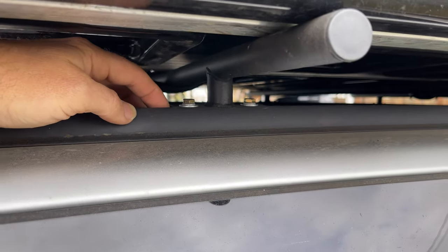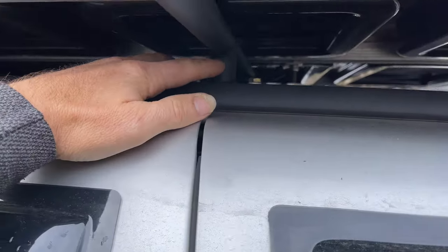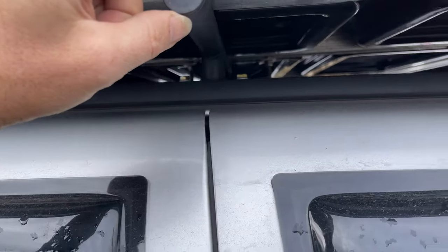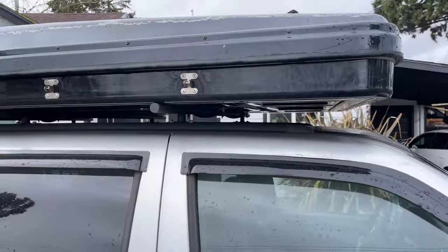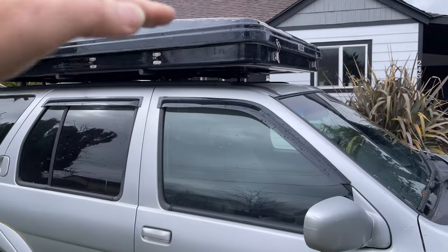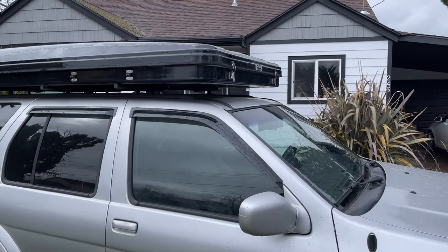Running the track, I made little plates with weld nuts and just screwed the hardware in. It's only about a one-inch lift here — roughly 25 millimeters of rise on a one-inch tube. The goal was a very low profile setup; you're still able to use the sunroof/moonroof option. You don't want it high up for air drag, and eventually I think I'll add some sort of fairing as well.